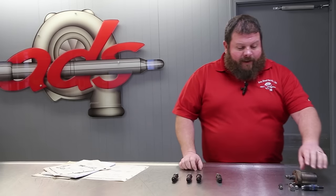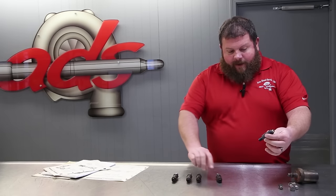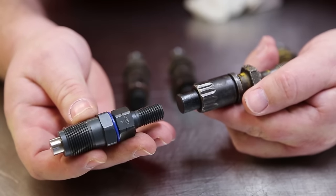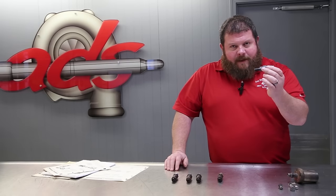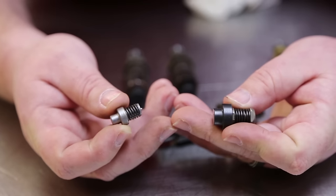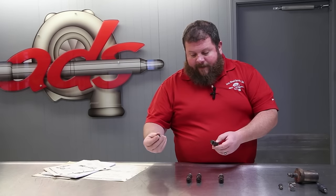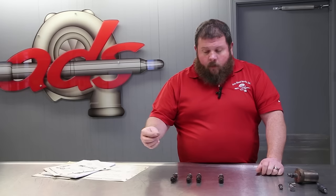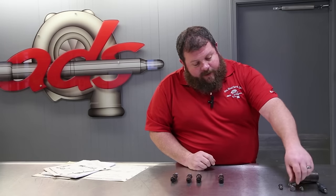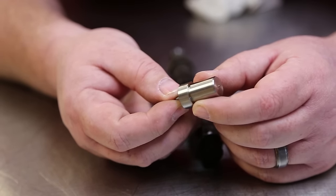Some of the other plans are in this pile of goodies here. This is a modern injector out of a Yanmar, and it's relatively close in concept, potentially. We've looked at it kind of roughly on a bar napkin. This could potentially be modified to fit into the hole. The valve that we looked at briefly that is currently available, we do believe that we could make effectively a custom nozzle retaining nut, modify this valve to fit in this valve holder. Opening pressure on this is not at the same specification, so it would require some modification in that regard. And then there are a couple other forward opening nozzles that potentially could enter into the scenario if and when we get there.